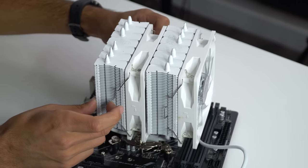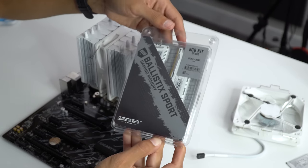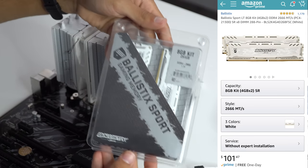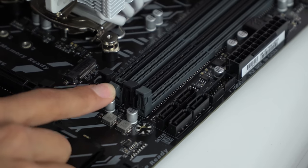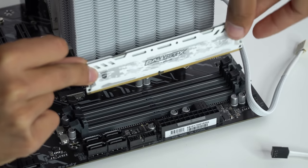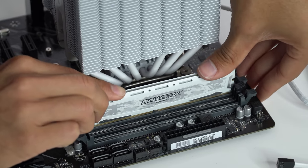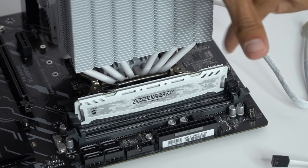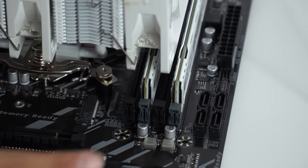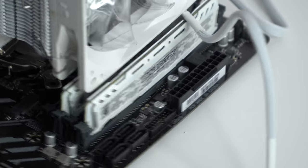Reinstall the fan and remove the fan blocking our RAM slots. For RAM, we went with an 8GB kit — two sticks of 4GB — rated at 2666MHz, which cost us $101. Open the gray RAM slots on the motherboard. RAM only goes in one way so you can't put it in wrong. Align each stick and press down with some force until it clicks in. This is low-profile RAM, which barely fits under this heat sink — if you're using this cooler, make sure you purchase low-profile RAM.